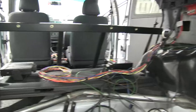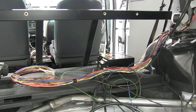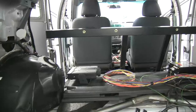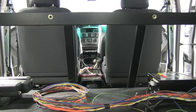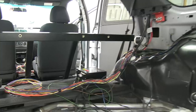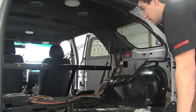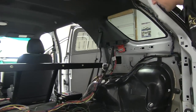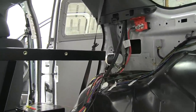We're now setting up the CENCOM and the radio area to a degree in the back here — just getting a feel for where things are going to go and what kind of space we have. Danny will then be putting the console in. He's already run cable up to the front with the wiring harness, which they build in-house. The light bar cables and antennas drop down the C pillar, so they're already in position with the headliner back in.